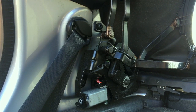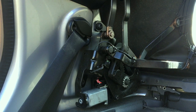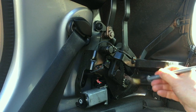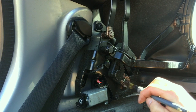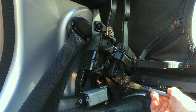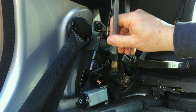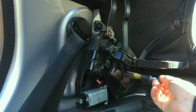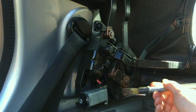Ordinary grease will do. You can actually use copper grease when you are changing brake pads — on the back of the brake pads, not on the friction bit. Once you apply copper grease it actually stops the squeaking. It's also good for things like ball joints, track rod ends, and door hinges — it won't do any harm at all.